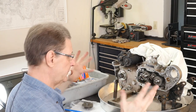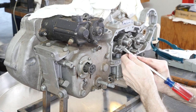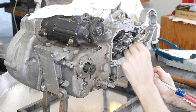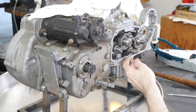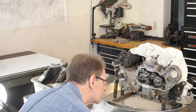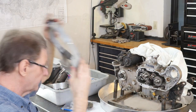So then timing these, where everybody freaks out and the gears all fall down. Timing them, you can see a stake mark, you know, a little slot here. There should be one here. This one, a little one right here. This one right here. This one needs a slot right there. There's a place you can turn this motor. I cannot see the slot. See, this is where the other tip I gave you about either this kind of magnifier or this kind of machinist magnifier. It's your friend.